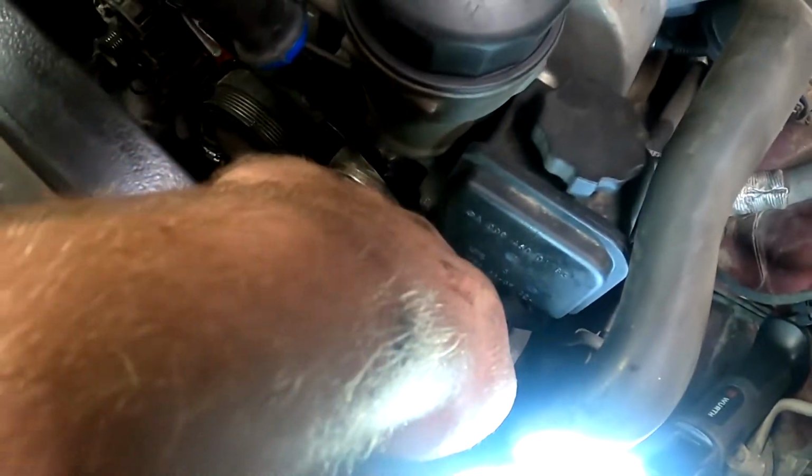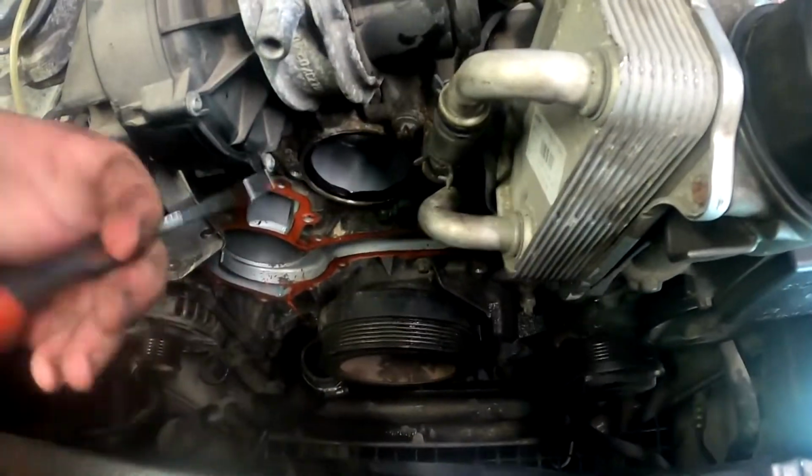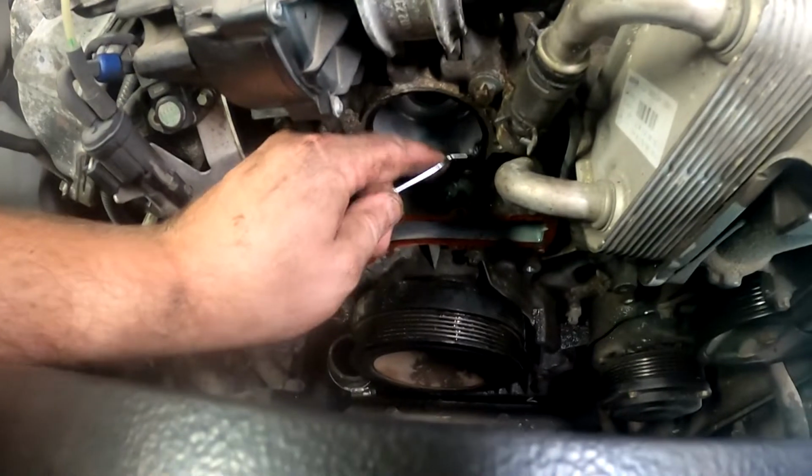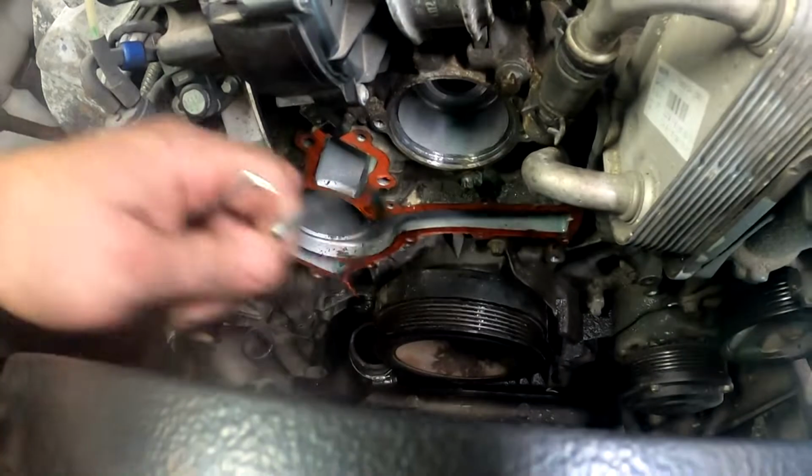So in order to take the tension off the tensioner, I put the pry bar here, which is standing next to here, so we can access the second bolt down there. If you can see, I don't think so. So everything is removed. Water pump, thermostat, you need to pull this seal out. This shouldn't be here, first of all, because the new thermostat comes with a new one. Pull this out quickly. So all the seal out, junk.